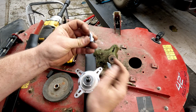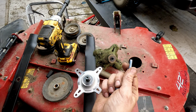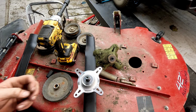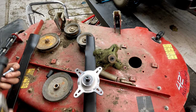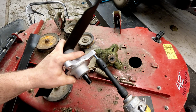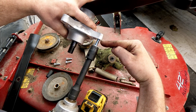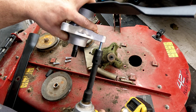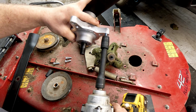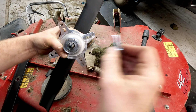These have a taper on the end that'll run right down in there and tap themselves. Otherwise, you can also use an actual tap and run it down in there to create threads. That's a 5/16-18. I'll put that in the description also. If you're doing them like this, just make sure that the end of your socket is parallel with the end of this, and as you start, it'll thread perfectly. Good threads.